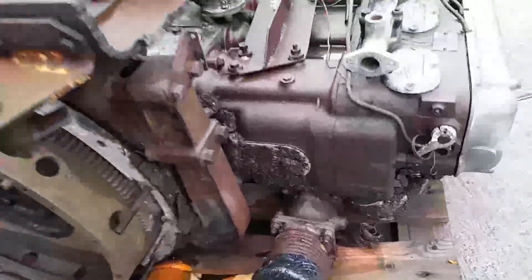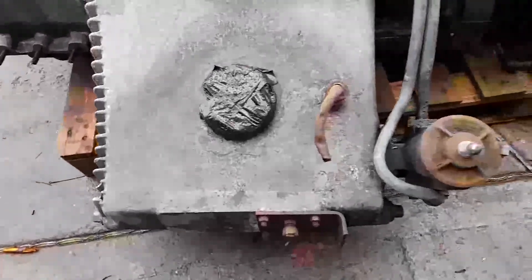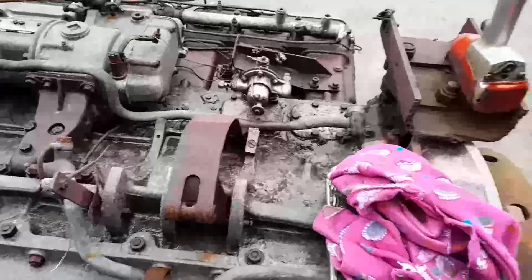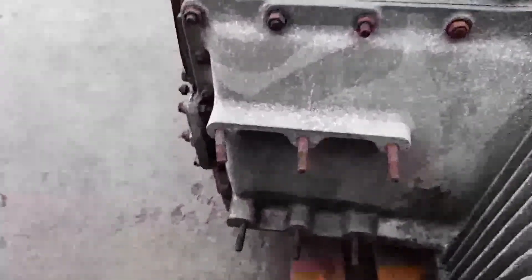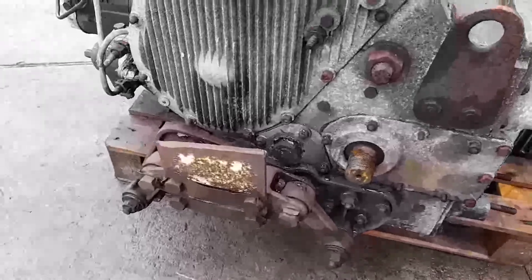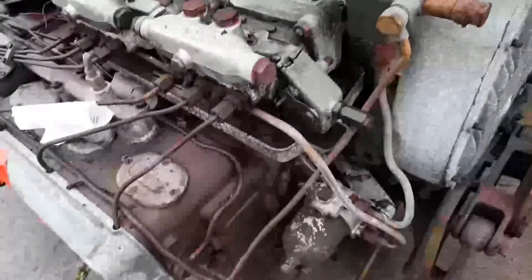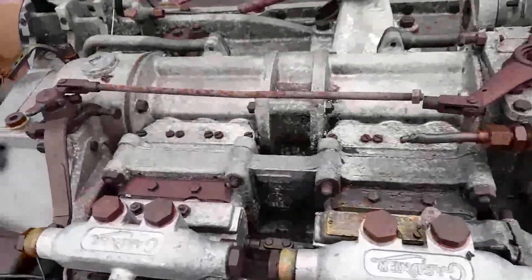This shows the engine just after we'd unpacked it. You can see the substantial mounts there, and the extraordinary sump here — it really is quite different from a vertical engine. That black plastic wrapper is where the original oil filler was, and we're going to have to find one because it's missing. You'll see the bracketry for the alternator, evidence of mounts, and oil cooling ribs on the sump. That's a bracket for lifting the engine, and semi-flexible mounts at the front. The fuel filter is much the same. The injector pump has horizontal type air vessels on it, which reflects the relatively modern Gardner design.